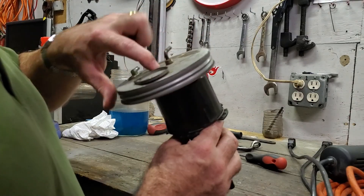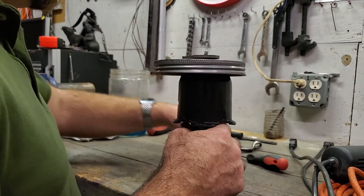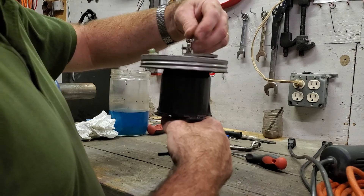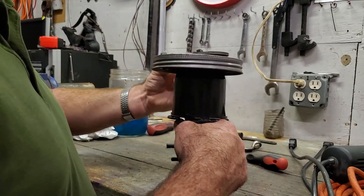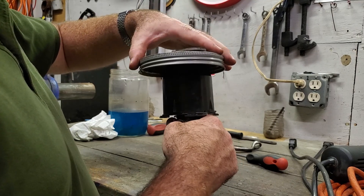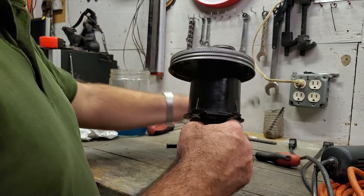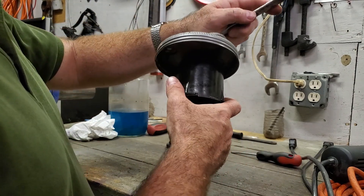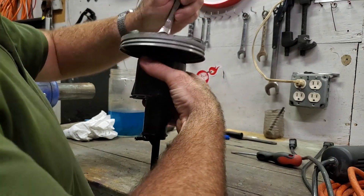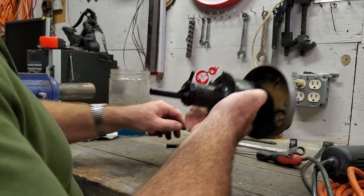In this instance that's quite easy because both of the pipes face the same way. It's a washer, shake-proof, then the nut. Make it sit into the groove that's made in the top, and holding the top piece just gently lift it up. It doesn't need to be too tight otherwise you'll break the plastic, and that all goes back together.